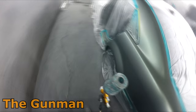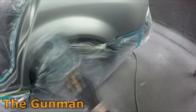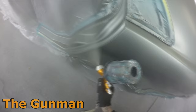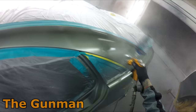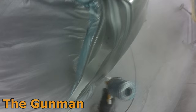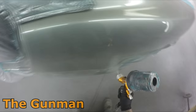There are a few things where I'd prefer solvent — for custom work you probably wouldn't bother with waterbase. Drying times are too long, and if you go to mask off and it's not quite dry, or you use paper, the waterbase will sink straight through it. You need to be using metal spray-out cards. Also, make sure the base coat is dry before you clear coat. You might get away with clearing over slightly tacky solvent base, but not with waterbase — you're trapping that wet base coat under there with no way for the water to escape.